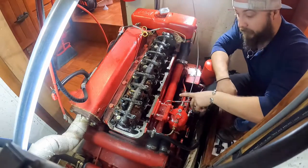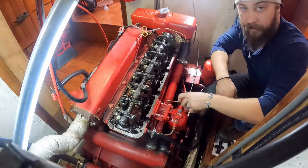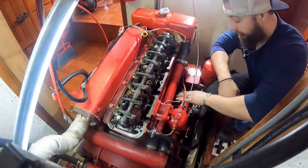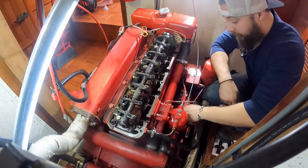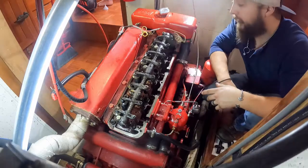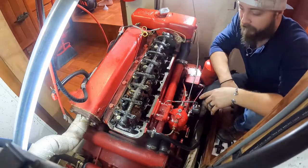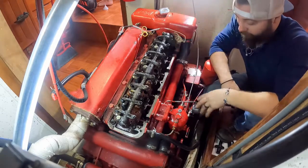I'm just going to pull these lines off too and check them out — they can split at the fittings even though they're hard lines. I'm going to pull it all apart and make sure we're starting with a good fuel system. This motor has 1,200 hours on it and once it's running it's good, but it's starting so hard that I think it's chasing air. And once this thing's in the water, that's when it's going to leave us stranded. So I'm going to take all this apart — this all started with just a fuel pump, but now that we've got a good fuel pump on it I'm going to chase all my sources.